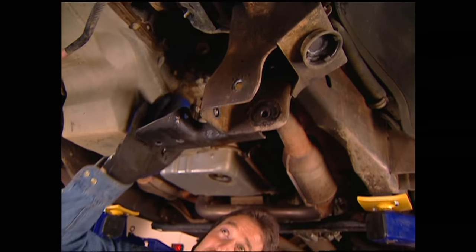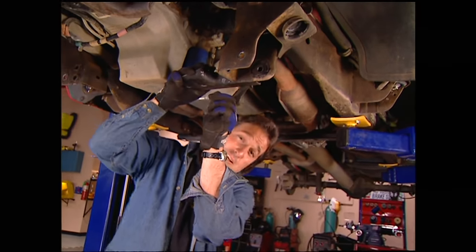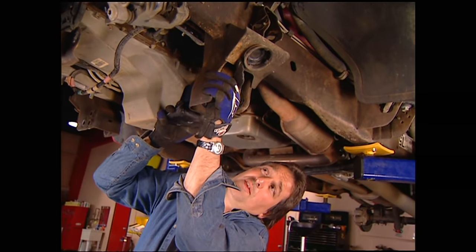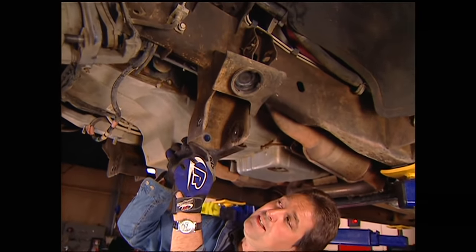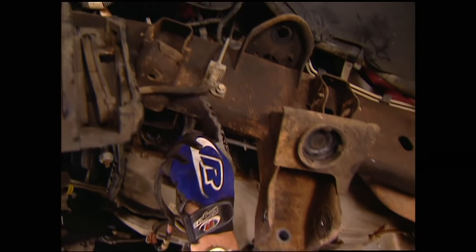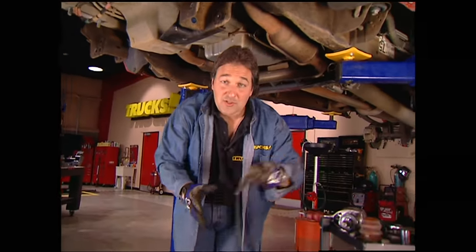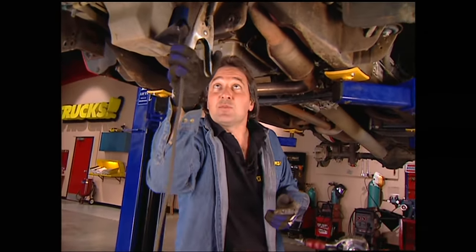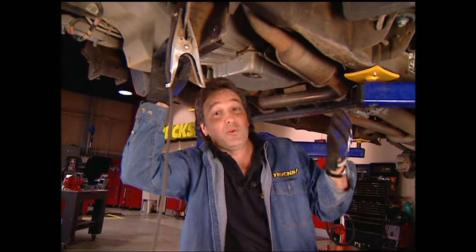On the driver's side, you're going to need to cut off this old differential mount all the way in here. Then come out here and cut off this old bump stop cup, because this needs to be smooth. Then come inside and cut out a three-and-a-half by four-inch piece. And finally, get rid of these alignment pins. I'm going to cut everything out with a plasma cutter — a reciprocating saw works just as well. Then come back in and grind everything down smooth. Remember, no matter which route you use, you still have fuel lines around here, so be careful.